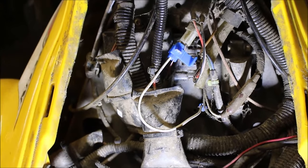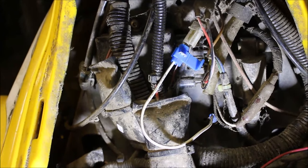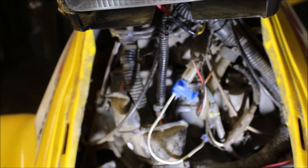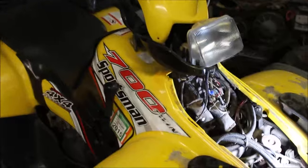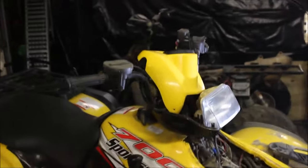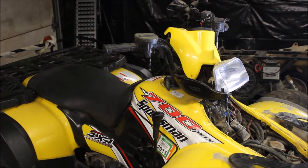I had seen this done on Polaris 500s — the 500s have two of these, and you just loop them together, ground both together, and ground it to the frame, and that fixes your four-wheel drive. I learned something new today and just wanted to share it. I didn't know the 700s were like that — I always thought if the speedo's shot, your four-wheel drive isn't going to work. I was pretty stoked to get the speedometer working by finding that worn-out wire. I'm going to re-route that wiring harness so it doesn't rub on the handlebars anymore, get it all buttoned up and put back together the right way. Hit the like if you liked the video, subscribe if you're a new viewer — I've got plenty of Polaris repairs. Until next time.